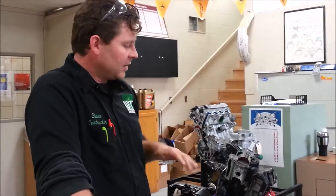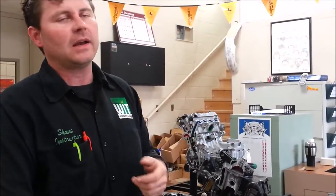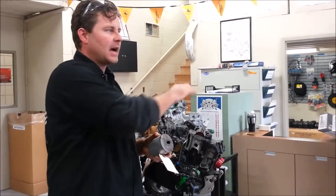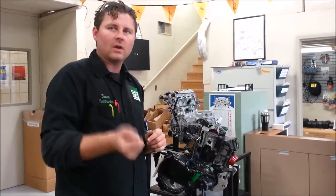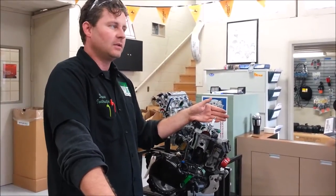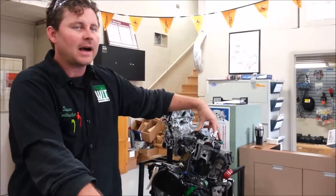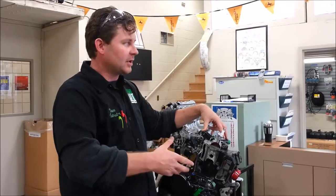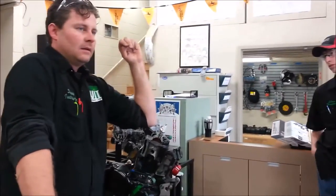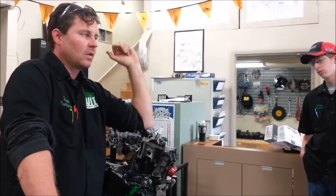Let's bring it back down to entry level. You're going to build these motors and your ignition timing is not adjustable on most of them. So what's the training piece you have to know for your customer? Ignition timing — we're making it stock, it's going to be good. The right fuel — quality of fuel. Your customer has to know that if they accidentally put a real heavy ethanol fuel in there and it's not designed for that, you could potentially have some problems. It's not common that we want to use ethanol fuel in the bikes because it's an oxygenated fuel. What did we say about oxygen in the Suzuki video? It raises the temperature inside the engine. So when you go to Casey's, you have two versions of 87 octane — the regular and the ethanol. You would want to use regular 87, not the ethanol stuff.